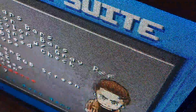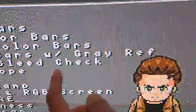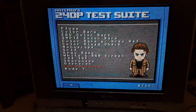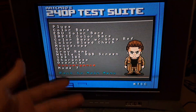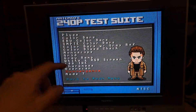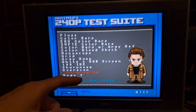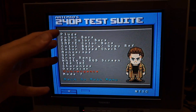From what I can tell just from looking at this picture, scan velocity modulation is quite distinct — it usually produces even bolder lines, and the little shadows on the back of these texts would be completely gone, making things super sharp wherever there are any dark spots. This one doesn't have that, so I can pretty much make an accurate assumption that it doesn't have velocity modulation in the first place, nor would it be turned on if it did. And of course, if it was turned on, most of the time — except for Panasonic — you could turn it off in the menu anyway. So just know that with those 14-inch models and this 20-inch, they don't have velocity modulation, or at least not one that you can disable. Also, I don't have the ability to access the menu on this thing because I forgot to keep a remote — so if you want to see the menu, the service menu is exactly the same as the 14AF4-2 and 14AF4-3, so go check out those videos.